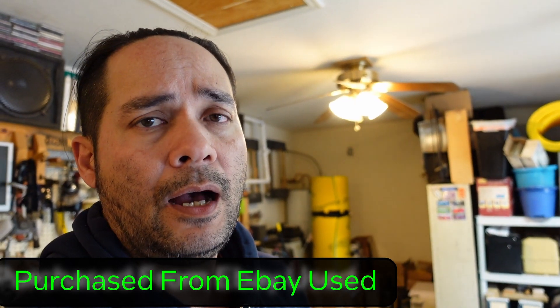It's a rainy day today and I just got off work this morning and figured I'd get to work on lapping in some valves on these heads that I got for this motor I'm building. This is my first video — I probably should have started recording a lot of this stuff a long time ago, but just now getting around to it. The project I've got in the works is a LS base motor, LY6 block, all cast iron. The heads are eBay 821 heads, and I think they have the sodium-filled valves — the 823 valves. What I did to the heads so far is clean them up, sandblasted the combustion chambers, and cerakoted them.